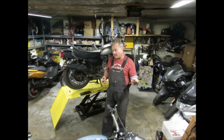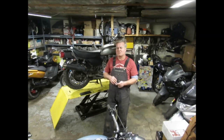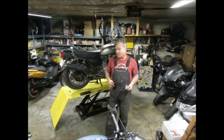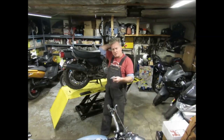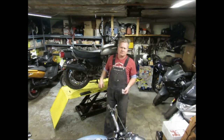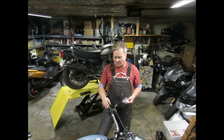Chains are really expensive these days — motorcycle chains used to be cheap and now a decent one costs quite a bit. I like a good quality DID chain. Chinese chains are poor quality steel, and if you run a cheap chain you might end up breaking it. At best it'll spit off down the road like a snake, but it could also wad up around your countershaft, lock your rear wheel, or punch a hole in your motor and damage your clutch push rods.